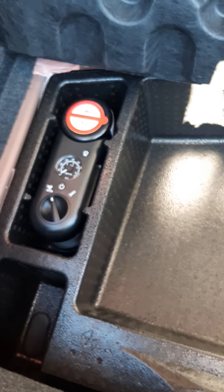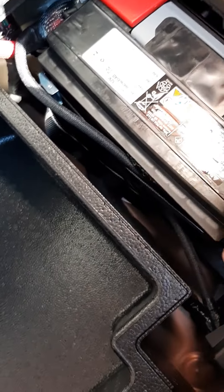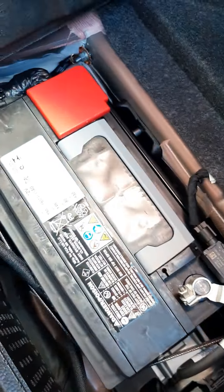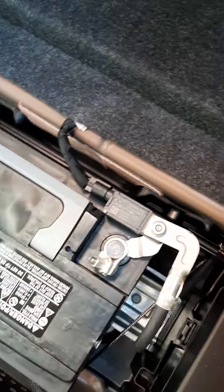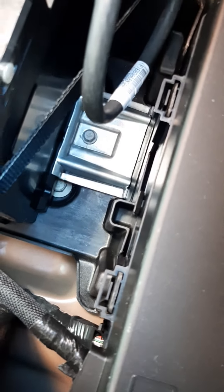So for the battery — you fold the trunk open and back here you've got your flat little compressor which I've never used, and you've got your battery. It has a strap on it that comes around — it's like a normal strap system, you just push and pull on it and it'll loosen up so you can get your battery out. It's a 10 millimeter to get your connections off, and also a 10 millimeter down there for your battery holder bracket.